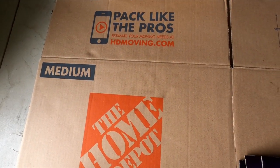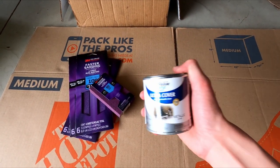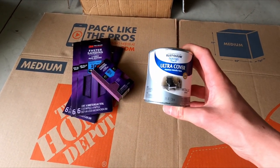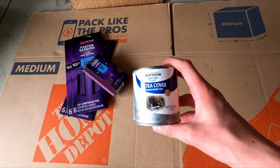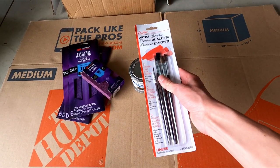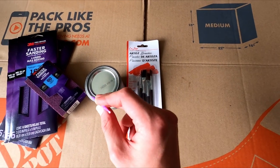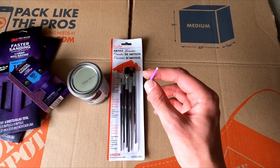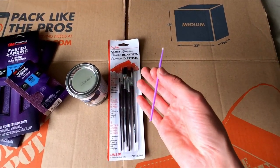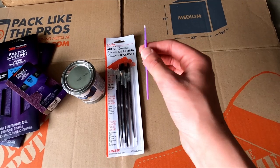Let's start out with the things I'm going to be using: different grits of sandpaper, silver Rustoleum, and this goes along with the sandpaper — this is for rust on some of the rock chips. If your rock chips do not have rust, then these two things are not going to be important to you, although it's not a bad idea as a preventive measure in case there's rust you can't see. Also paint brushes, or this touch-up brush — this is really what you want to be using because it gives a streakless finish, more of a dab. I'll link some in the description below.